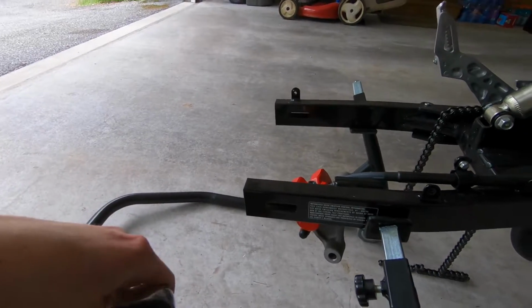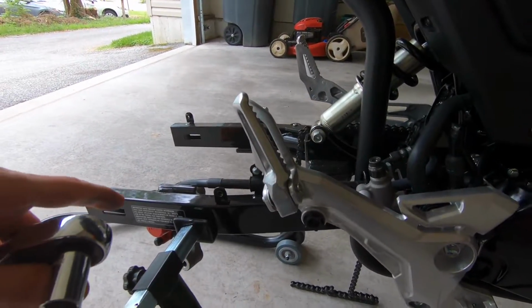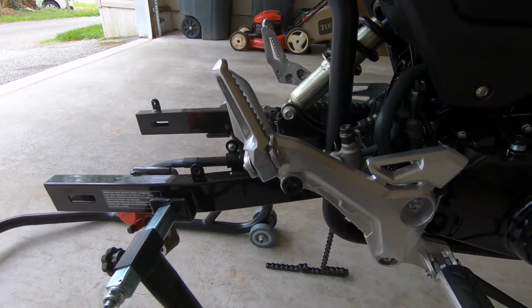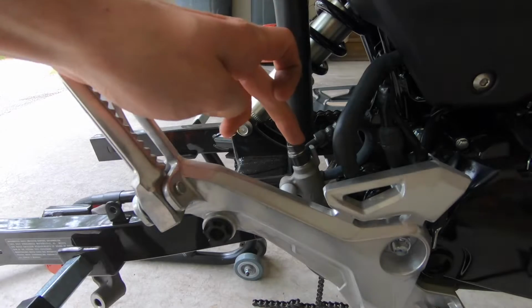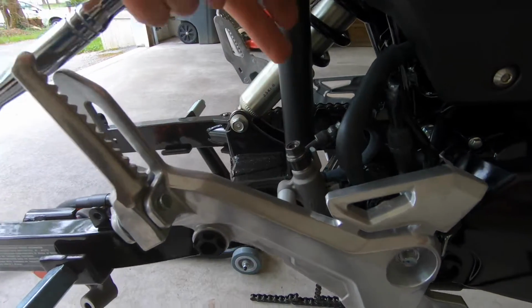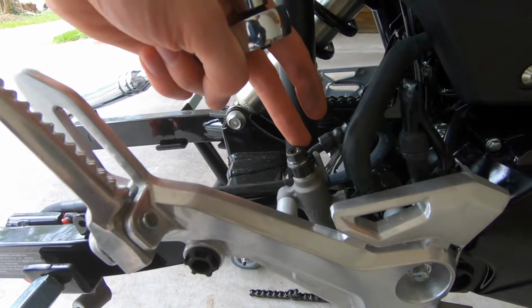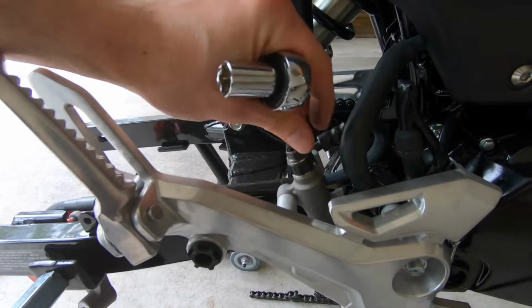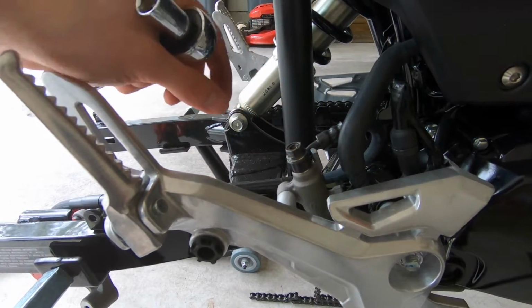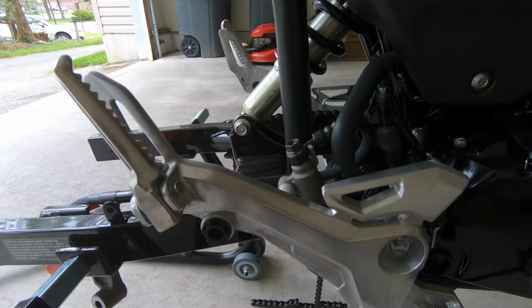Now that the wheel and the stock tensioners and stuff are off, to allow for the stretch, since I'm going for the longest stretch I can get, you gotta loosen up your brake line, because from the factory you can probably see in here that there's some extra that runs down through. So just by loosening this up just a little bit to allow this to turn and then tighten it back up, you're in good shape. You don't gotta worry about bleeding lines or anything like that.